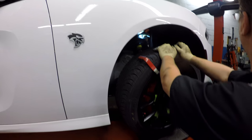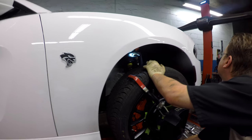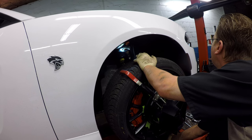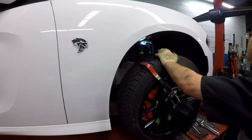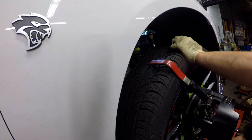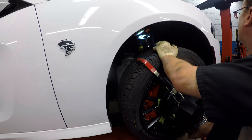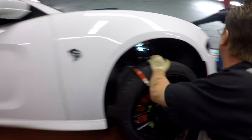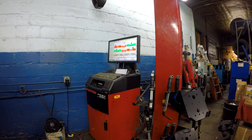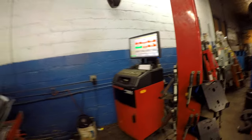What do you want on the right side? I'm thinking negative 1 degree or 1.2 degrees on the whole front — maybe 1 degree. 1 degree would probably be pretty good for handling. You want it equal — or we could do 1.2 on each side, whatever you think. Now you can see he's doing this and it's changing on the screen — he's able to play with the camber completely. That's what's awesome about having adjustable upper control arms.